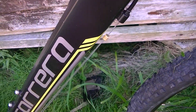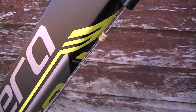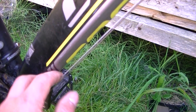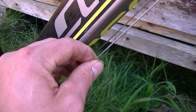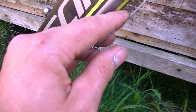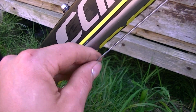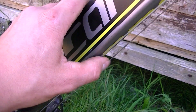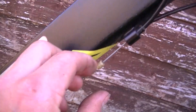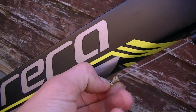The cables are routed on the down tube. It's not one of my favourite designs because all the mud tends to congregate on the cables. What they've done to mitigate this is leave the cables free with no sleeve, because if you have a sleeve, water gets trapped between the sleeve and the outer and corrodes the cable. But it does mean the cables rub on the frame, and you end up with paint and clear coat coming off over time. There are little spacers to mitigate that, but they've gone rock-hard, as they always do.